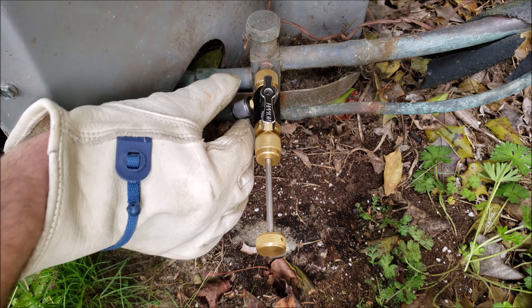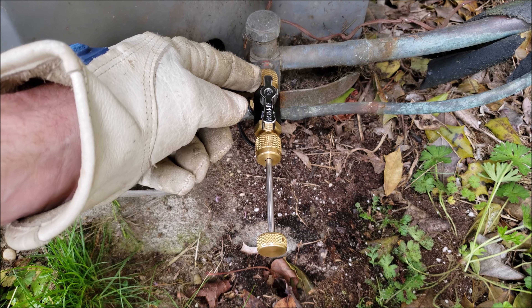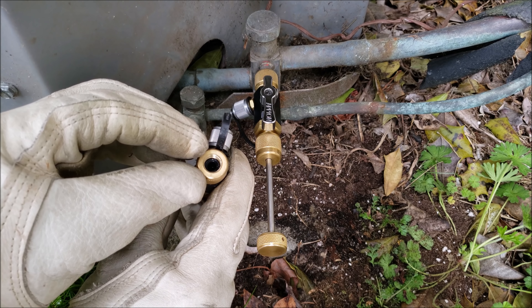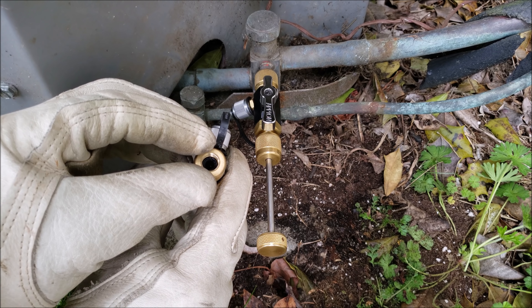You want to make sure that this side port right here is snug, and you want to make sure that the back is snug but not overly tight. You can keep this fairly tight at the beginning, but then we're going to loosen it up. What's happening is this little rubber grommet inside is getting squeezed, and when it gets squeezed it's going to be blocking the pathway for the valve core.